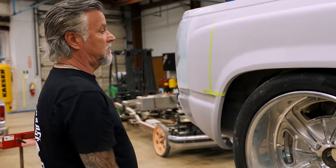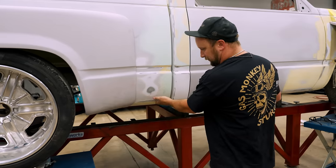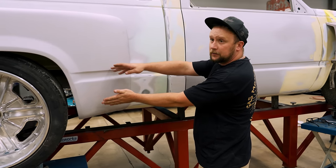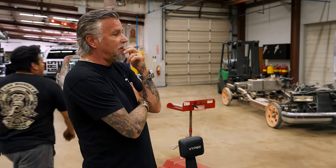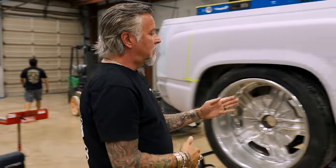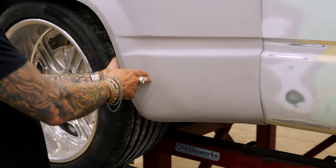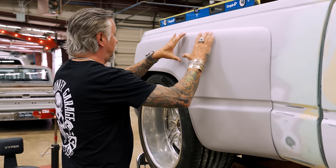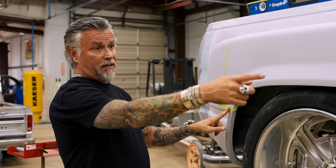Okay. So if we cut this out, maybe do it, because I'm building that canard lower skirt. It could pop up there. And then to fill just that void, we could do a couple of canards running up in there. That would be pretty cool. Yeah. Let's play with it that way. Okay. I would say get some cardboard. Yeah. And let's come up to the wheel like we're doing in the front, about the same amount of space, follow the body line, come up more flat like we're doing there, and back, and then end that thing just like we're doing there, 5 inches back.